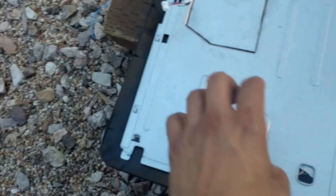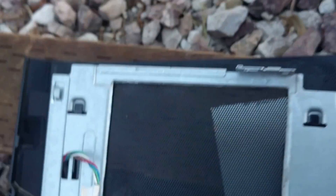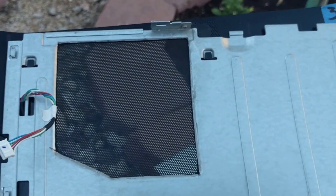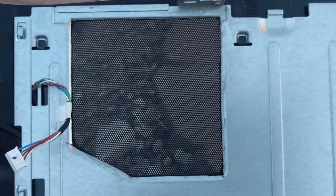So what I did is dremeled all this out and I put some mesh on there. If you look closely, it's not perfect, but it's all I need — it needs more air getting out. Some people say that you need to do the GPU exhaust fans and not the CPU, but they both have hot air so I just did the easier side since this side was already beveled in. I just took the Dremel and followed the outline.